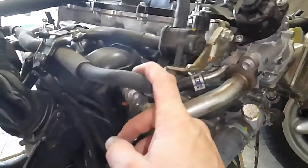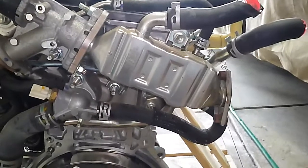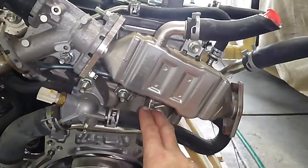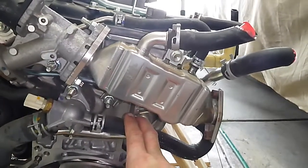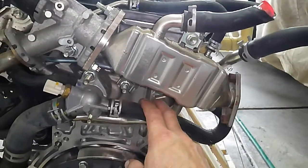This line is going to go to the tank. We'll take this line off and use the one that's in the car, then put a tee in there. Now the other lines back here — you've got the EGR cooler. I diagrammed all this out because there's no way you want to mess this up. The way the old system works, this line here goes to the heater core, and then from the heater core it goes to the catalytic converter.